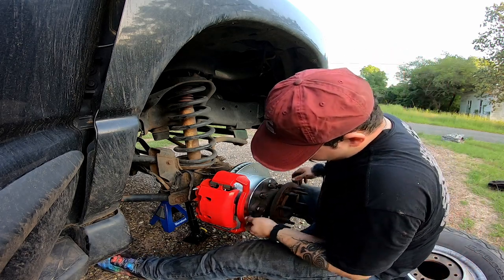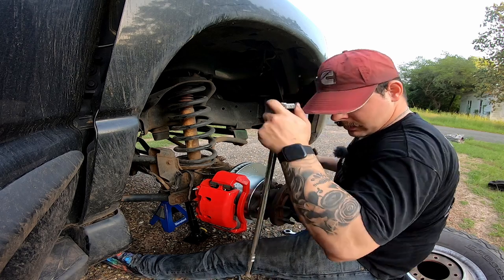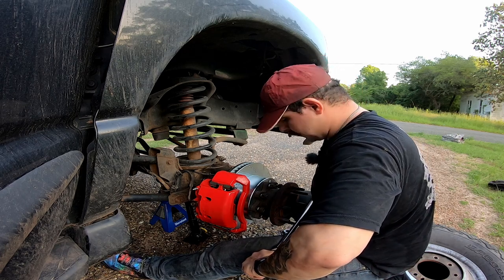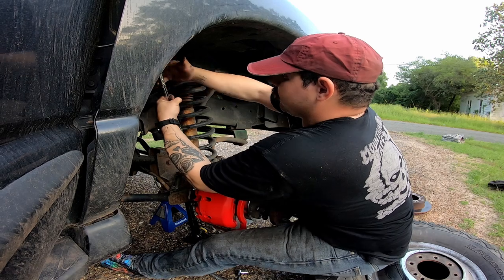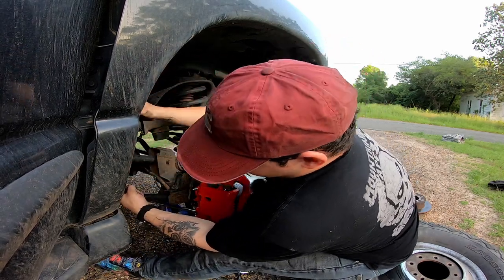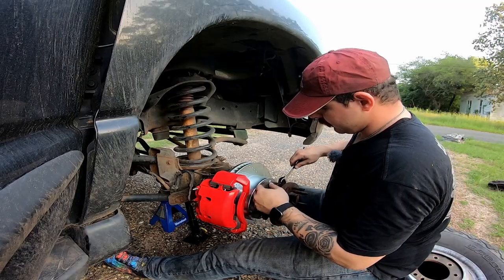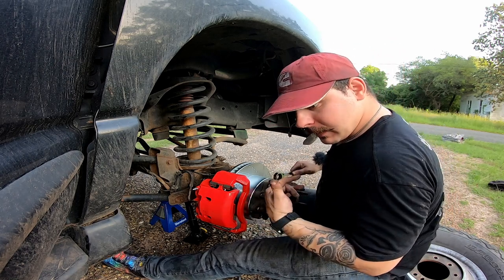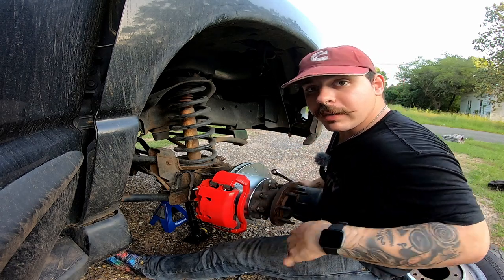Now that you've got your mock-up and all your parts, you're going to want to make sure that you tighten those bolts in the back to your manufacturer torque spec. Keep in mind they are brake parts — if they are too loose, you're not going to have brakes. So these get torqued to manufacturer torque spec. Then you slap your wheel on, or in my case spacer and wheel. These are going to get torqued too, because this is connected to the wheel. I'm not responsible for your wheel falling off — so these go to your manufacturer torque spec.